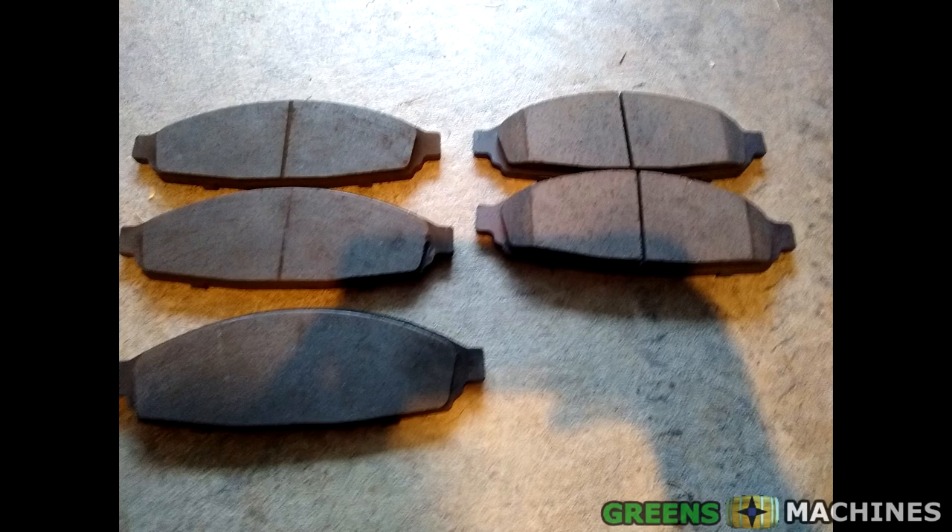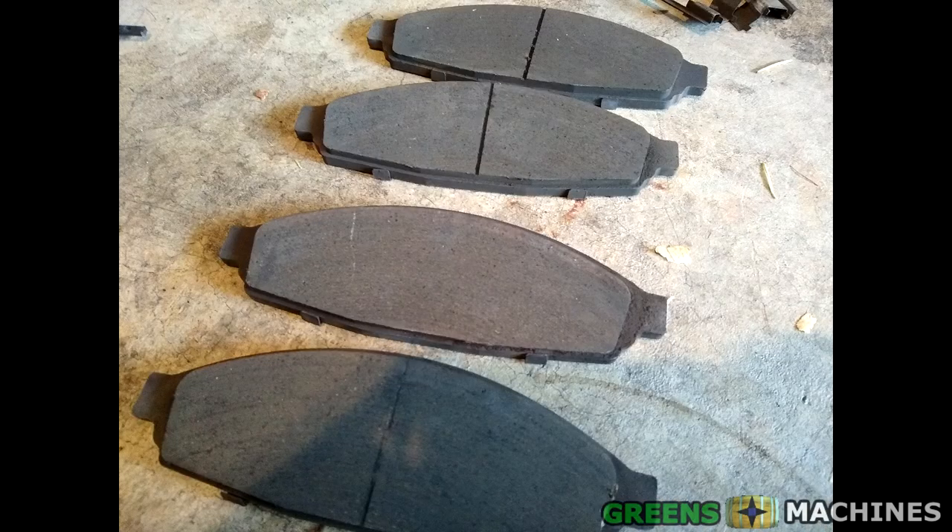As you can see in this image, the two pads were pretty worn down compared to the new pads I have to install. Also shown here are the pads I pulled off the other wheel. You can see how unevenly worn those pads are on the driver's side compared to the passenger's side — that must have been causing all the vibration.